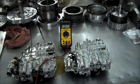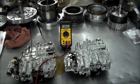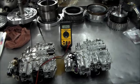Things change over time, so you have to do some research. I believe in 2009 and 2010, that particular solenoid should be about 3 to 4 ohms. So if you have wrong information and you're checking an 2011 or 2012 car, just be careful. Make sure you have the right information when checking these, because it can really throw you off.